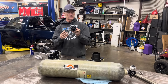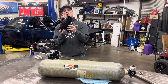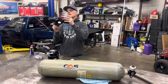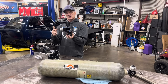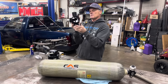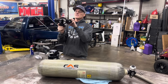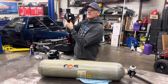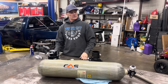The lock-off valve turns the air on and off, then it goes through this Bosch drive-by-wire throttle body, which is regulated to control the boost curve throughout the run. The last component is what we call the ejector valve. It sits by the throttle body — when the lock-off opens, air comes in through the dash-20 and a tube directs it directly into the engine. This valve shuts off any outside air, so the engine is solely running off the bottled air.